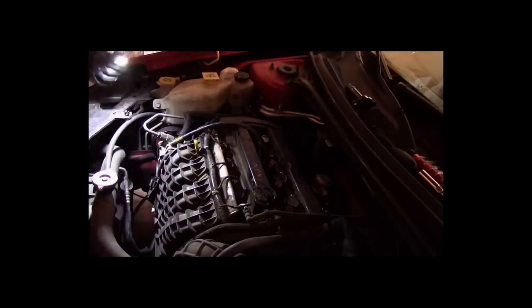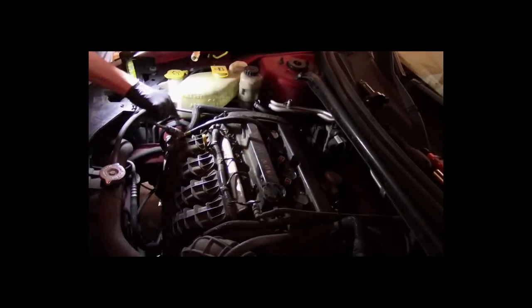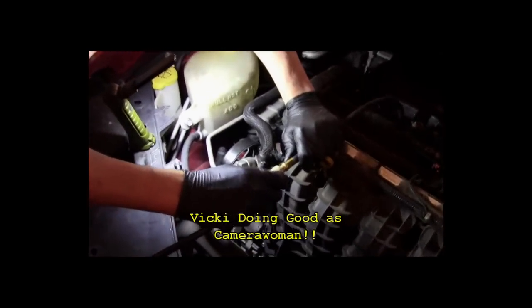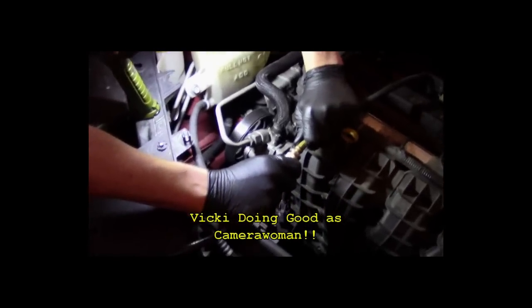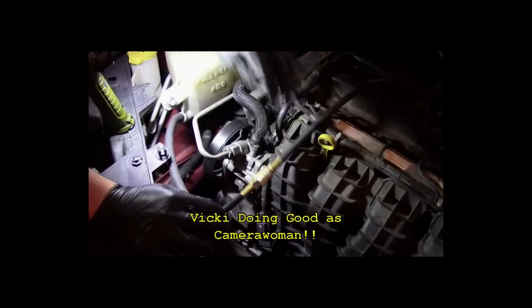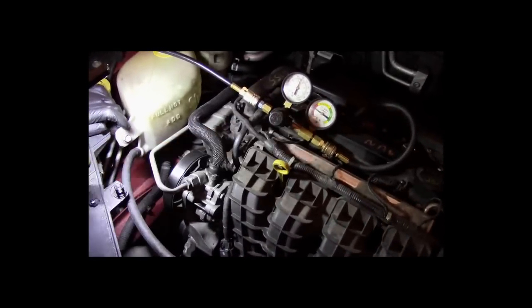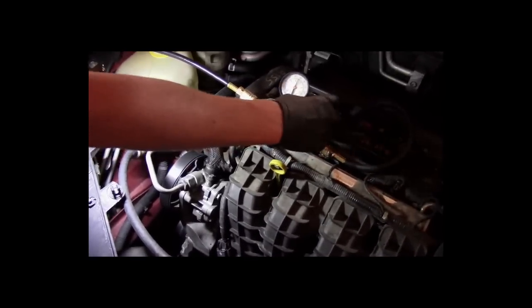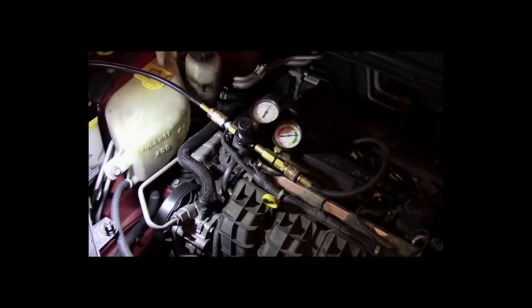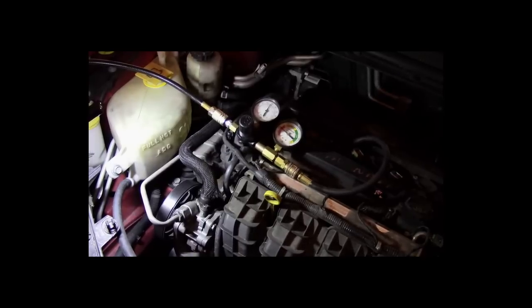In order to check engine rotation, Vicki, if you want to look and focus the camera on this wheel here, and if the engine rotates, then I'm going to say we probably have compression. Oh, it does. Well, I might have been wrong then. Sorry guys, we're going to go ahead and work through the noise here. I'm going to turn the engine over again, and we're going to look at our leak down percentage. Oh, it's good. Wow. Okay. Well, this is an ignition problem.